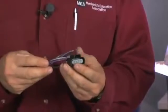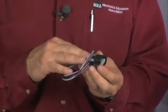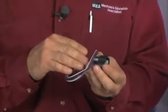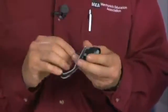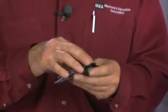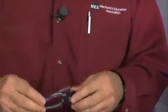Sometimes, depending on the testing that was done prior to the fuel pump replacement, the electrical harness itself may be damaged or it may have holes from testing in the wiring. So there are electrical harness connectors available to make sure that we have a good electrical connection at the pump, and obviously, again, making sure the pump runs at the proper speed in order to provide good performance.